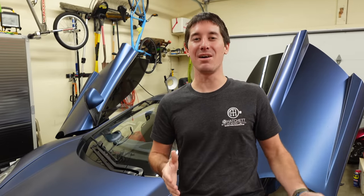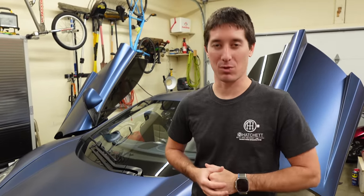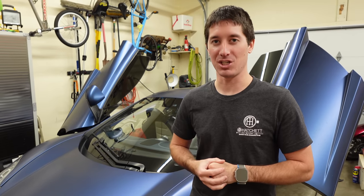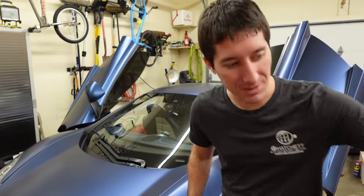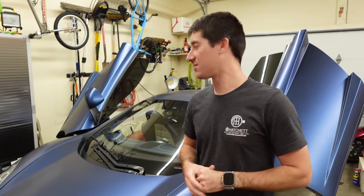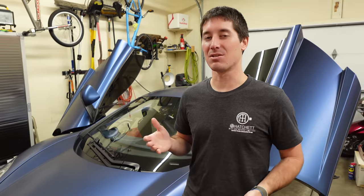What is going on, guys? I'm Watch Jericho, and like I said, I'm here with my 2012 McLaren MP4-12C, the car that was named after your local fax machine. And in the last video, of course, we took out the normal old door latches and we put in some used Tesla latches. One of the boxes for one of those latches right there, and they're both in the car, and neither door soft closes. And that's because those latches are used.